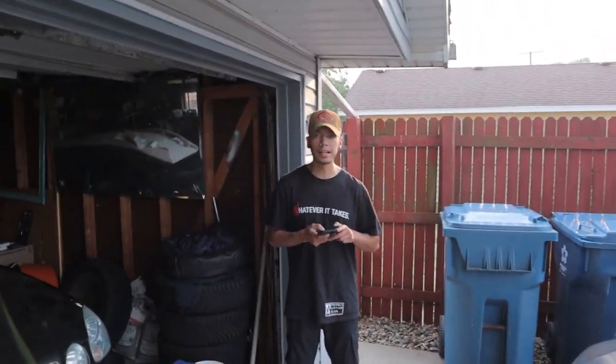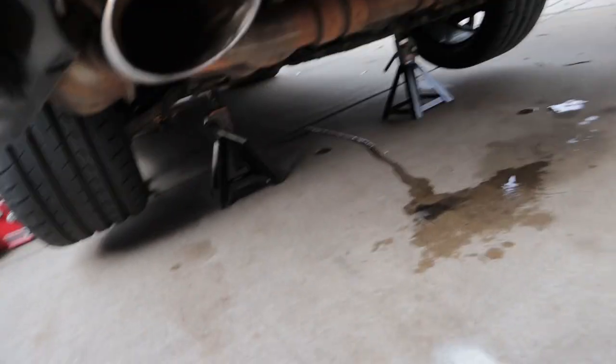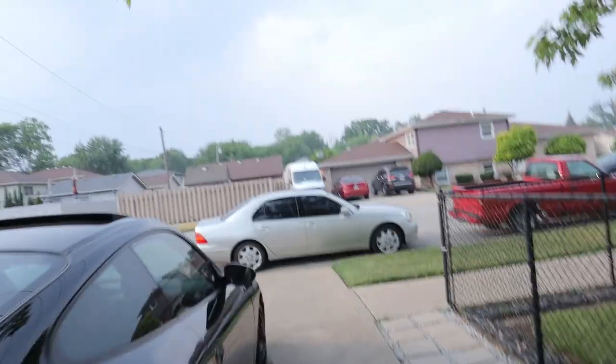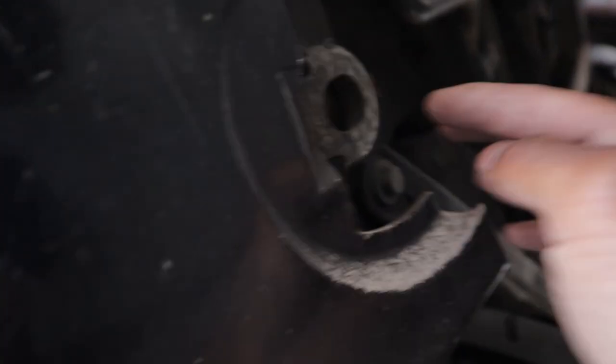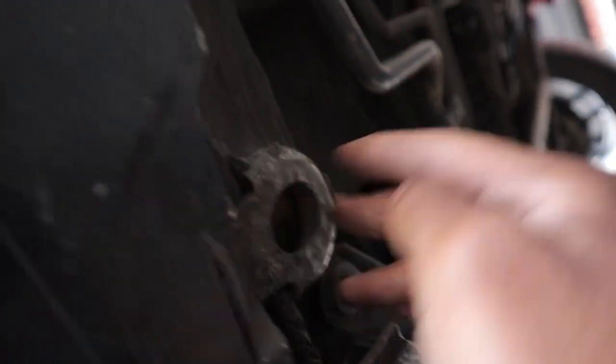Marl walked off on me because Kayla called and it's not a Kayla day. It's Tuesdays, Thursdays, Saturdays, Sundays. It's Monday. Anyways, without bullying him — right now we got it jacked up and on jack stands. I'll show you guys where to jack from. This circle piece right here — that's where you put your jack. You should have a pad with a long bar that goes from one all the way to here, so you can jack on the bar and it gives you a little more height.